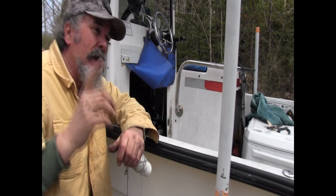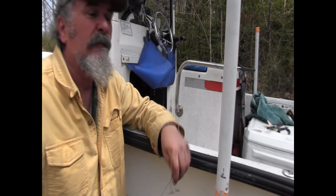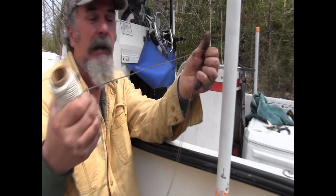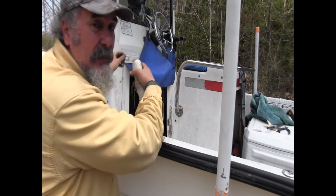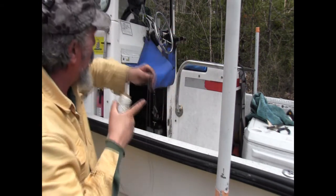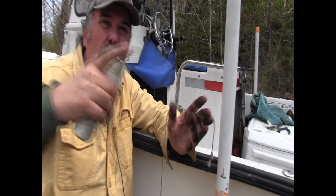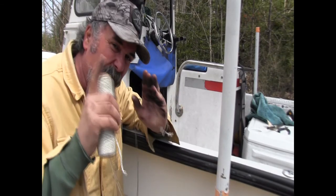Now, some of you may have done this in the past, and I think I might have done it once, but not with a steering cable, forgetting to attach my guide rope. Now see, this guide rope is critical. This little piece of twice strong, it's probably 180 pound test, 200 pound test. I'm going to attach this to the end of the rigging cable here so that when I pull it through, I'll be able to use this to pull the new one back. If you forget this, I don't want to live anywhere near you because the woods are going to echo with some expletives, okay? So don't forget to do this.